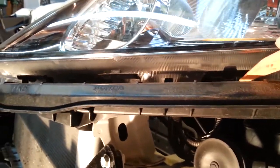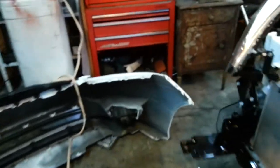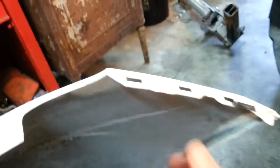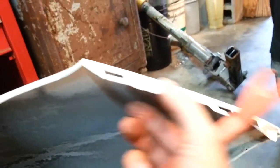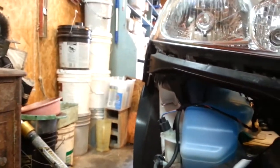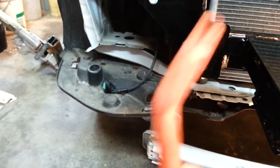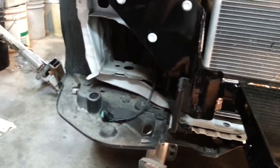If you can get a little plastic tool in there and push down, that'll help it come out. I took this plastic tool while the fender was on there, got in here, and just raised up on it slightly - raise up and then pull, popping each one out as it came around. You can see on the fender how it's made - these little slots that it snaps into. One of these tools - I sure would get one - it's really handy to pop all pieces off with.